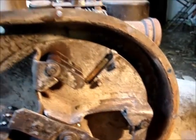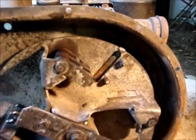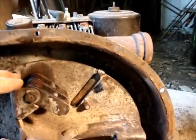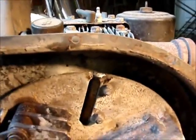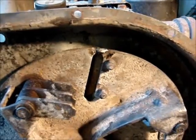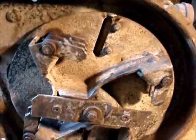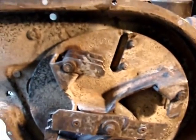As I'm putting this together, there was a crack in this flywheel right here. I got the welder out and welded it, and I didn't want to grind any off because I wanted it to be as strong as possible. I put a gob on this side in the same spot — it didn't look cracked there, but if it was cracked, it's welded, and if it's not, it'll kind of keep that in balance. I didn't want to grind any off. But it's going back together and it'll be back together here shortly.